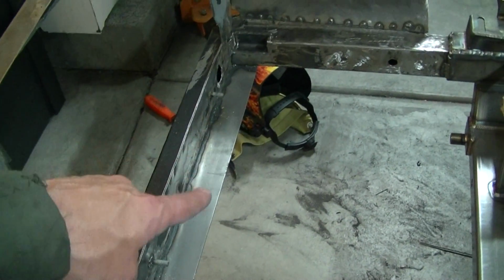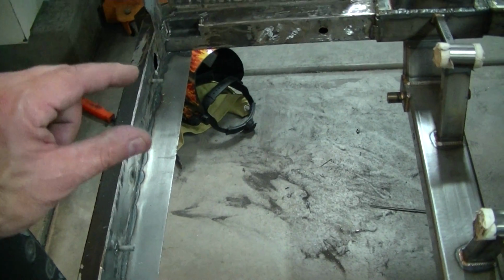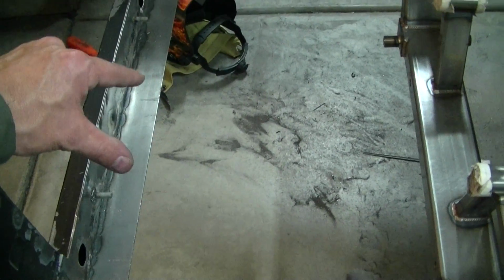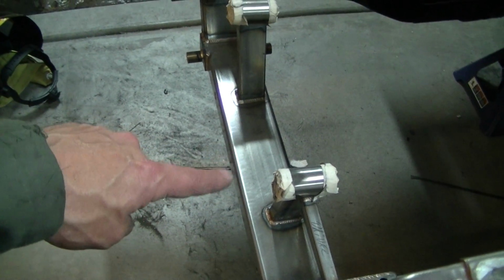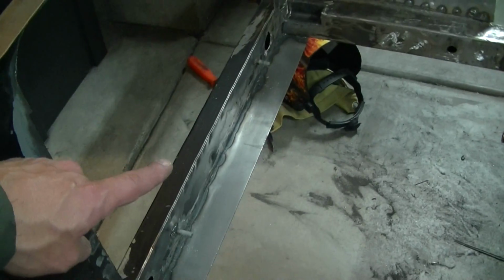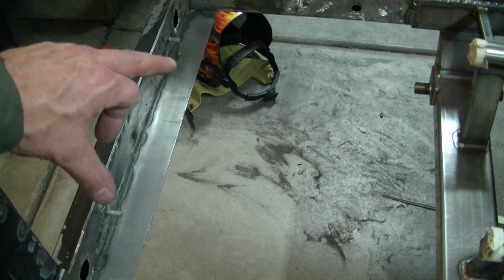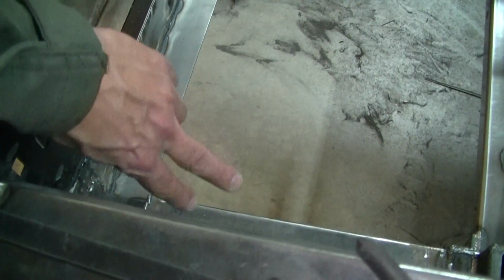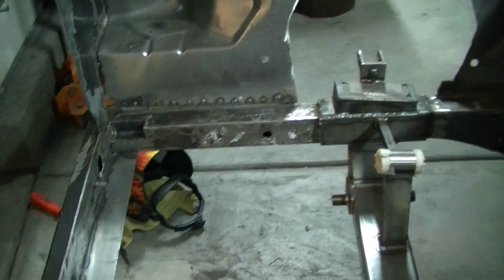the little panel there, just to get it flush for when I run my jack pad, because I'm going to get a piece of angle iron about that thick, about 4 inches. I'm going to put a jack pad there, and I'm going to have just bars going here and there to reinforce it when I jack it up. Because I don't want to jack it up on that thing. That's too nice. When that's painted, that's going to be too nice. Plus my rack is going to be right there. So I'm going to build a jack pad and weld it under here, and it'll probably be, I don't know, 6 inches wide. They're about 6 to 8 inches wide. And I'll just have a couple cross pieces going there and there. That'll help strengthen the car. Granted, it'll add some weight to the nose, but I'll just overcome it with horsepower, right?